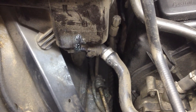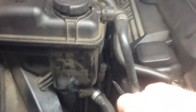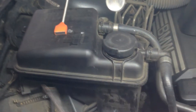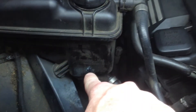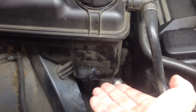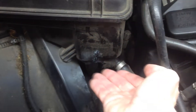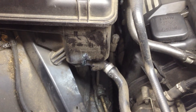So what I'm going to do here — you have two options with the expansion coolant tank. You can buy a new one, but then you have to connect all your new hoses here and here down below, which shouldn't be too much of a problem. I'm going to try to do a cheap fix under a couple bucks: I'm going to clean that off and just smother JB Weld — the quick one that dries quickly — all over that right there, and it should hold the pressure in and stop that leak.